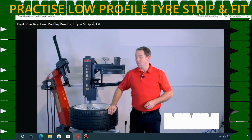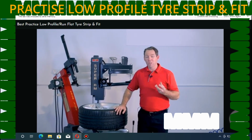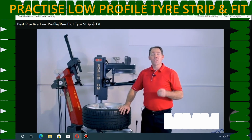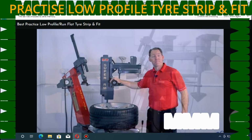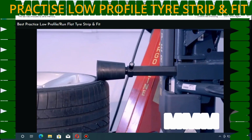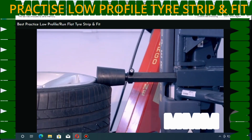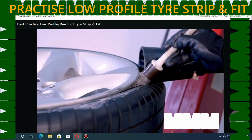At this point, due to the rigid sidewall, you may find that some of the bead has reseated to the rim. So to address this, we're going to use the multifunction roller. Press the roller down on the bead and rotate the tyre, once again being mindful of tyre pressure sensors fitted to the valve. Brush in some more lube if required.